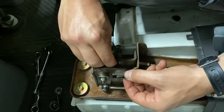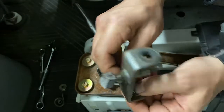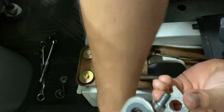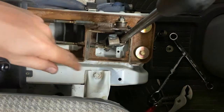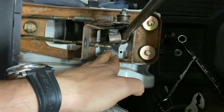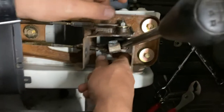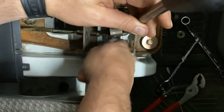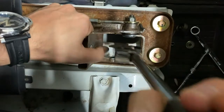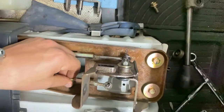The bushings for this piece are on either side, so you pop those out and replace them — grease everything and put them back together. The final part we're going to replace is down here. There's a cotter pin that goes in that hole — if you break it like I did, don't worry, the kit comes with new cotter pins. Pull off that spacer and set that aside, and then you can pull out the entire shifter, which will make replacing those bushings easier.